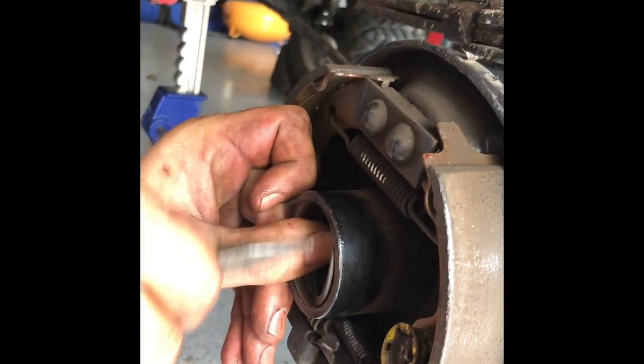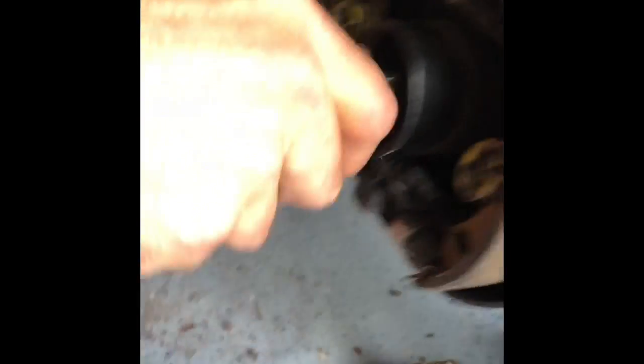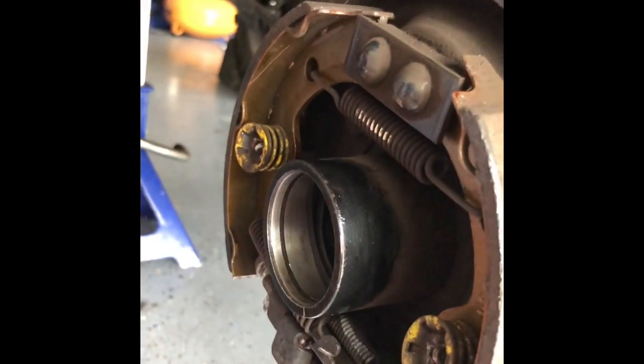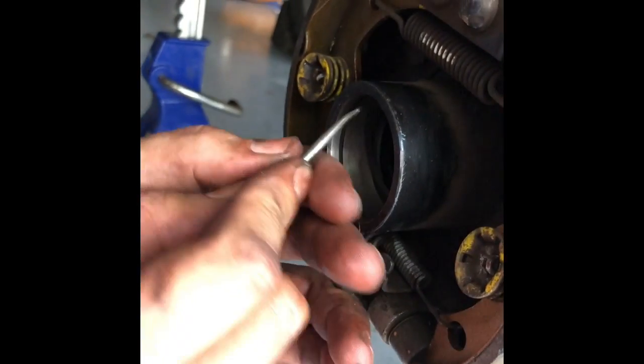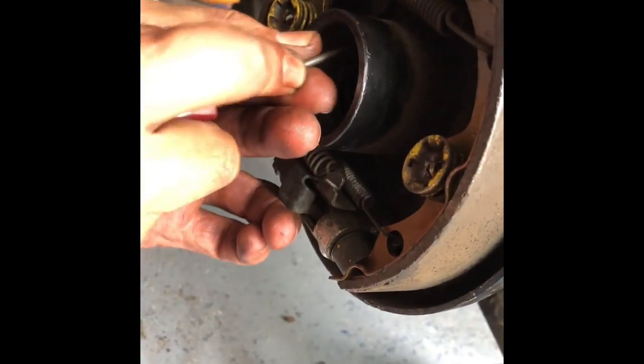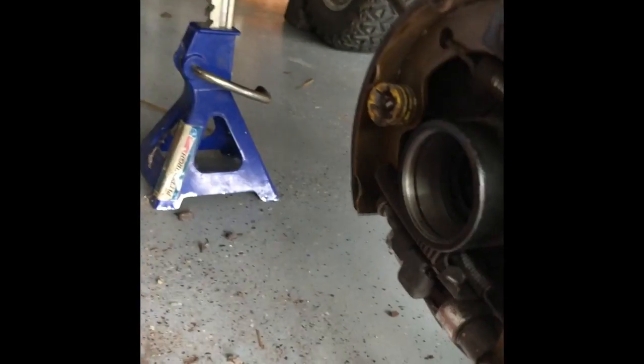Take the first snap ring and start going backwards the way you had it — put it in and apply it again. Push — try not to mess up the seal surface. This little o-ring puller is worth its weight in gold — it'll push, pull, do everything you need to do. That one's in, that's in there nice and clean. Put a little hit right here cause I put a scratch in it — that's cleaned out.